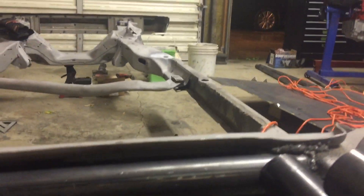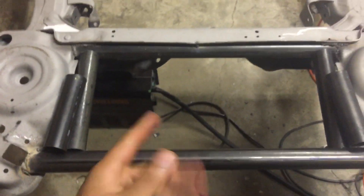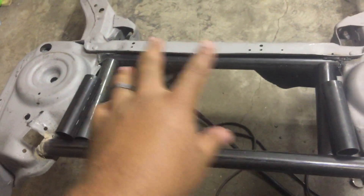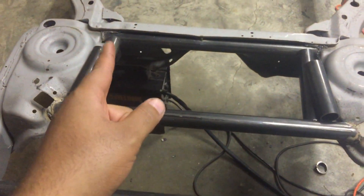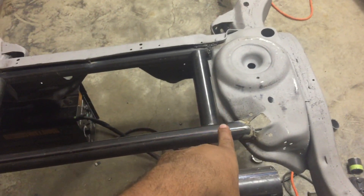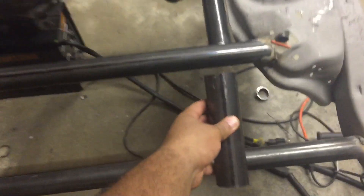I got them all in. The main thing I've been focusing on — looking up other people's videos — is exactly how they got their stuff routed. I see some people make diamonds or triangles, I've seen X's going across, also just straight. Easiest thing for me is probably going to be where I got these big ones right here go straight down, weld that up in there so it's connected to the shock tower, weld it up to both ends.